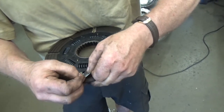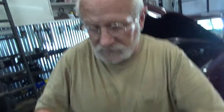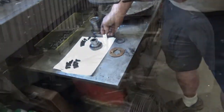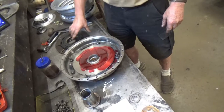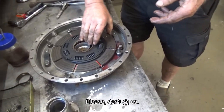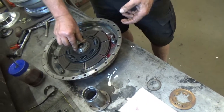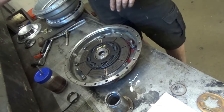These sort of minor and seemingly insignificant details make the difference between a nice job and one where you're tearing your hair out. I'm going to put just a wee little bit of automatic transmission fluid in here now to keep the clutch moist. Then just lay the clutch disc on here, and we'll put our clutch hub back in place so that the clutch disc spins on the clutch hub. Put a little bit more fluid on there just to keep it company.